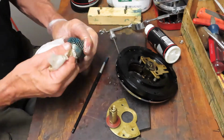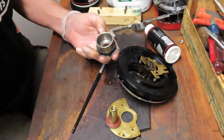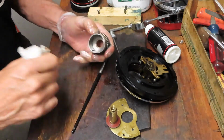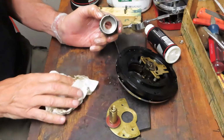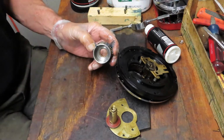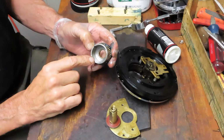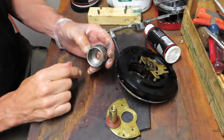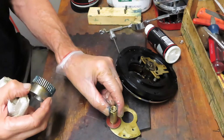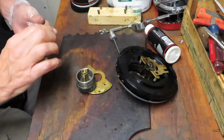Okay, we're going to clean out the inside of the channel now. Check for scarring. Sometimes that metal gear will wear through. The washers didn't wear through here. These are the asbestos ones, but particularly if you have the conversion to the HT100 ones, check for scarring. If a metal one came through and scarred, there's nothing much you can do other than probably replace it. All right, back on to the shaft then.